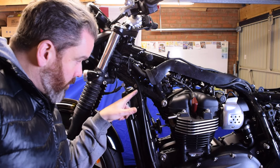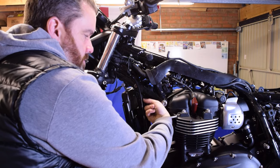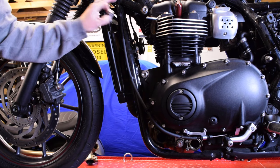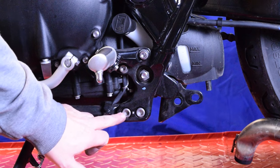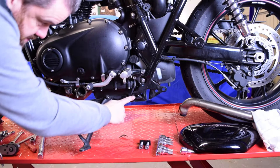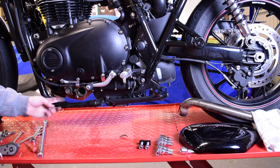This is where it gets a little bit more involved. We need to undo the top bolt for the frame rail — that's an 8mm allen key with a 14mm nut on the back, so you've got to get a spanner up behind here onto the nut. That's the most fiddly bit. The next bolt is where Triumph mix their sizes: 16mm on the bolt, 17mm on the nut. Then undo these two allen head bolts — again 8mm — which have a captive nut bracket on the back. With those two undone, you can move the lower frame rail to one side to get the catalytic converter out.